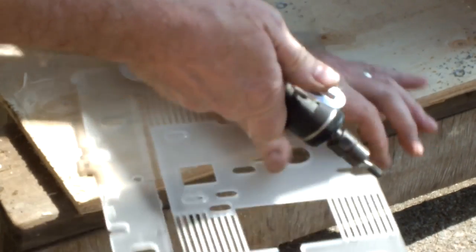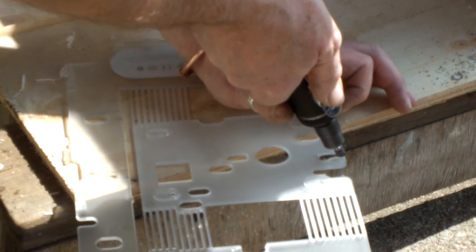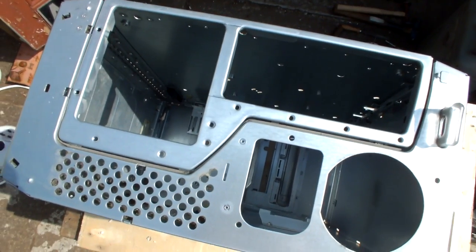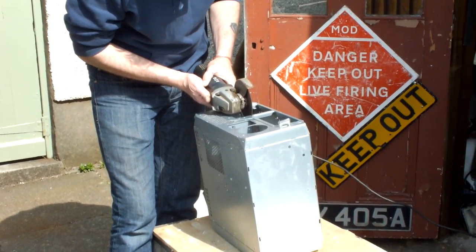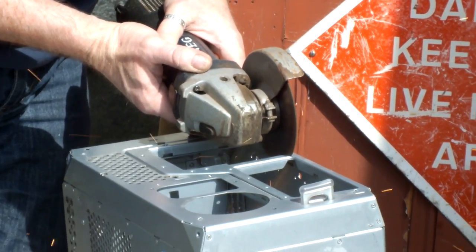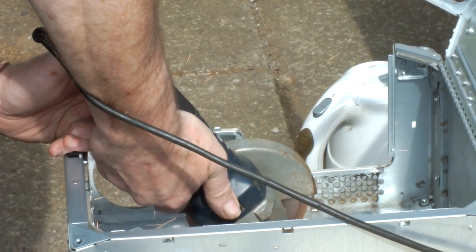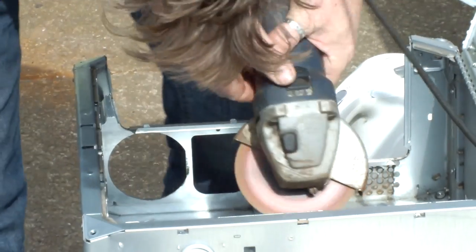My case, after all put together, is going to work perfectly in terms of the latch. It also keeps a bit of the original internal look having that plastic on the motherboard tray. So we're drilling and dremeling away at the plastic because the whole thing moves when you use the latch. It's important that the standoffs don't obstruct the latch from moving up and down, so you have to make longer slots to allow the entire latch assembly to move. Very interesting design and something I did not expect to get working, but we've got it working and I'm so pleased. After attending to everything on the motherboard tray, the instructions directed us to start looking at the back of the case. This is the original back of the Quicksilver pre-modification - in just a second, it's all going to change. After this, there is no turning back.